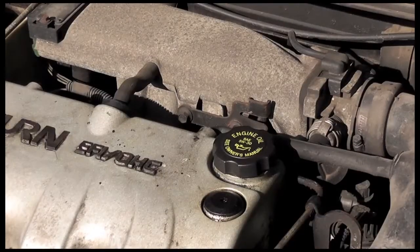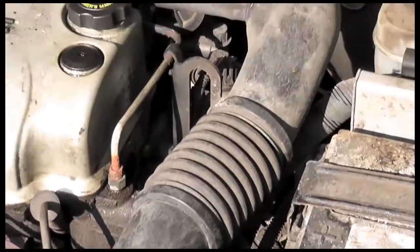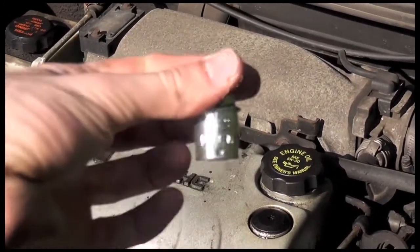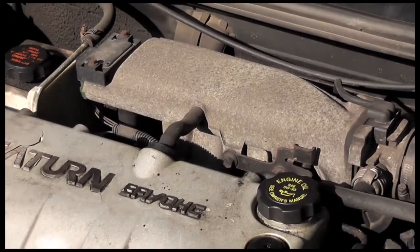So we located our intake housing — this is the air box right here. Then it leads back to our intake manifold, and right here is the hose that our PCV valve is going to go into. Your PCV valve, sometimes called PVC by accident, is this little valve. These gum up — you hear this one rattles because it's moving freely inside.